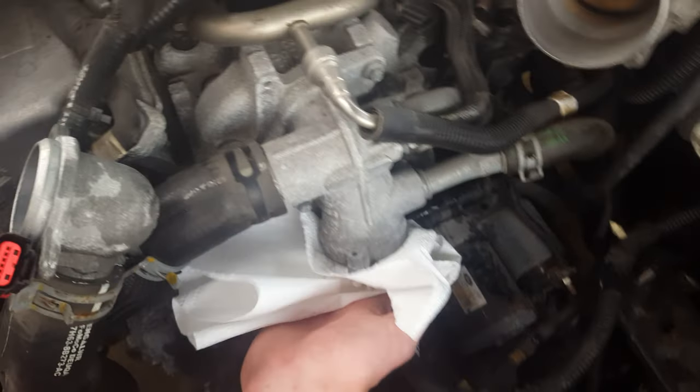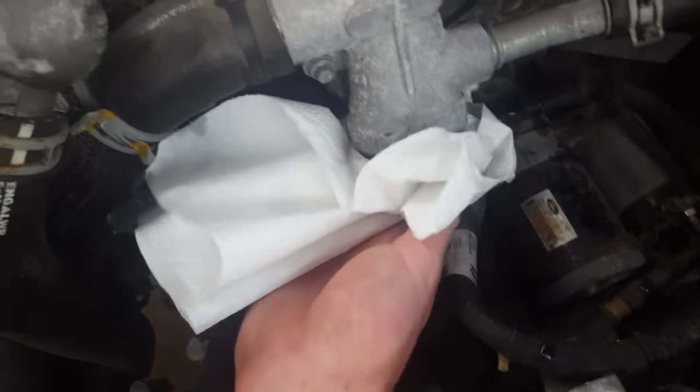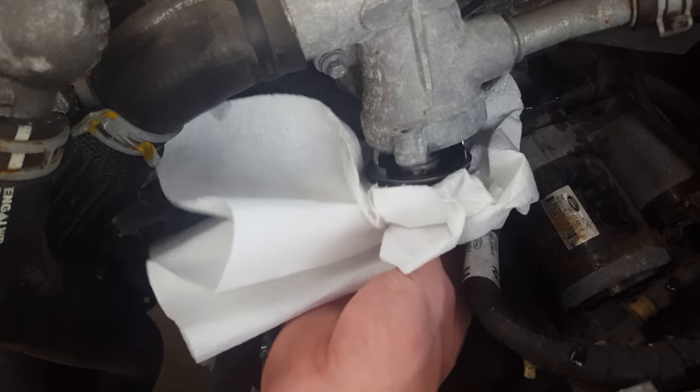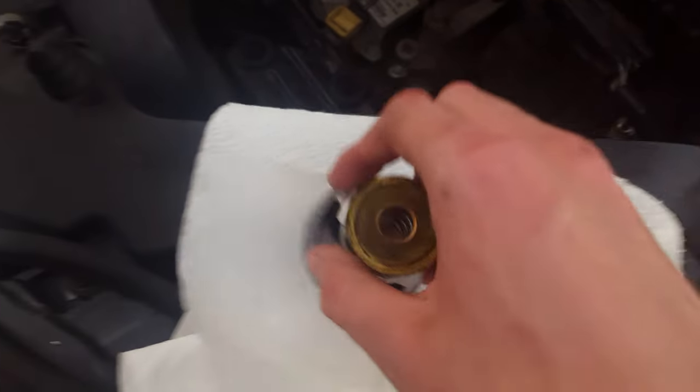My car is a little bit hot — not scalding hot, but it's been sitting for a couple of hours. I've got a rag so I don't burn myself, and just kind of wiggle the thermostat out just like so. After you've done that, I would recommend replacing your O-ring on it, though mine looks like it's all right.